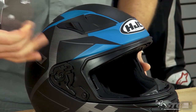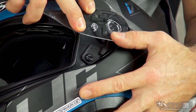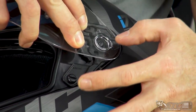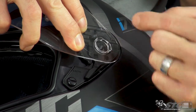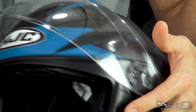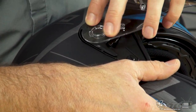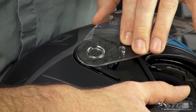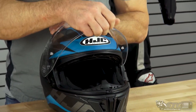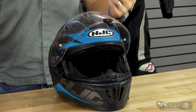For reinstallation: support the helmet and mimic that upwardmost position for the shield. You'll see where the slots align with the tabs on the shield — find those and put a little inward pressure. It'll jump in and you'll hear an audible click indicating it is firmly seated. Repeat the process on the other side. Before riding, operate the shield up and down completely a couple of times to ensure you have it installed correctly.